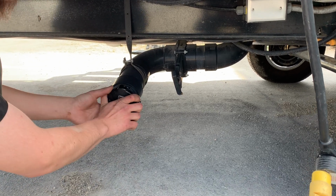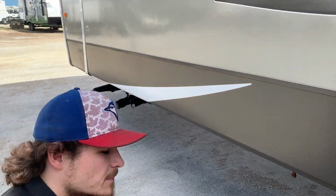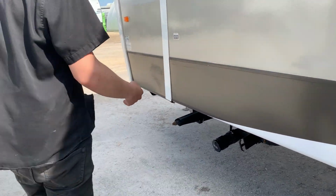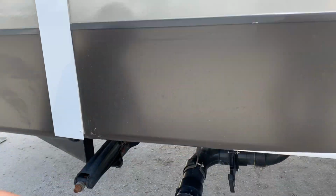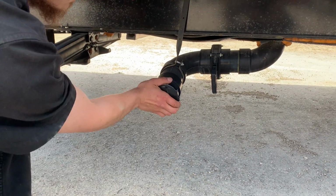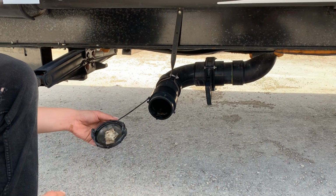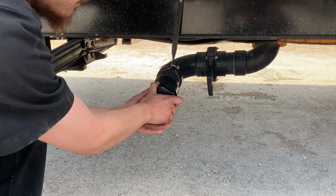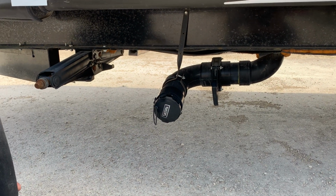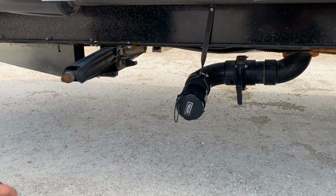Once you got that tank dumped out, you just move your hose to either the back or the front sewer system here. The back one we've been over. The front one here, this gray tank, is just filled from your kitchen sink, so it's most likely to be your cleanest water. So as the same thing here, you just open that up, attach your hose onto there, and let it run out. Doing the black first and then the 2 grays afterwards just ensures that the hose is getting cleaned out with cleaner water rather than sitting there with the black water in it.